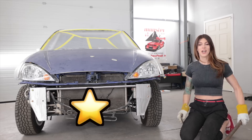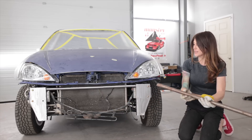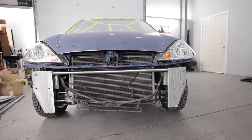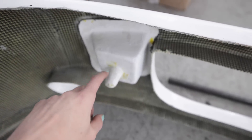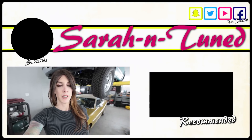Now you're starting to see what it's gonna look like. I thought I could do this all in one video but this is already three full days of labor. Basically it's gonna have an X-shape in the center piece of flat plate, and then I've got to recess all these bolt holes with the pipe — so there's another day at least of labor on this thing. It kind of has the shape of a front mount intercooler almost. That's gonna be sick — way overkill. I've also got to make the holes where these are gonna sit because the whole purpose of this thing is to house the front bumper cover. I'm getting pretty close to being done on the fabrication. Hope you guys enjoyed this video — let me know in the comments your thoughts on the Focus, and I'll see you soon.